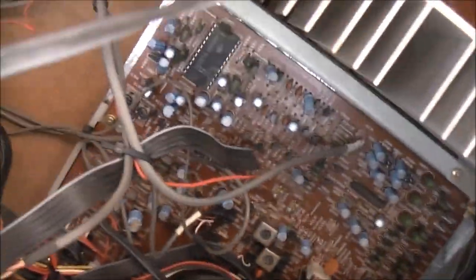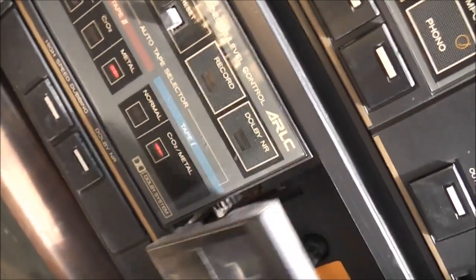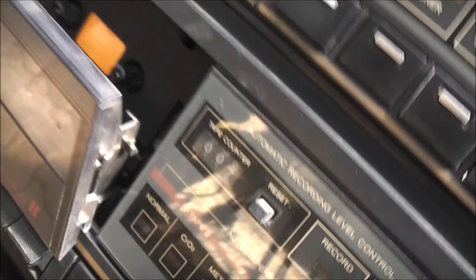Although this has got plenty of room in there, which is good. I've got that motor running just so it can stay freed up. The motor's still going but there's no torque on the belt — that's why I put rubber renew on there. The flywheel goes with the take-ups a bit, getting better. The whole mechanism was all stuck with stiction — it wasn't going until I gave the flywheel on the capstan a kick and got it spinning, and they took off. That one here will do an override, but if I'm not recording this unit turns off, so I can't do record player taping that fast. But I can with this one. Auto tape selector — normal. I'll put a cassette in there, it goes to normal mode. Metal mode by default — normal.